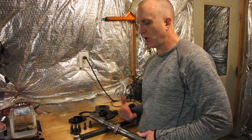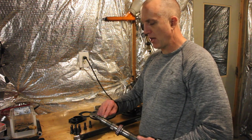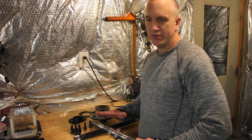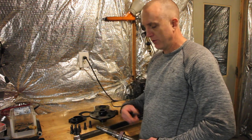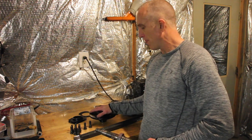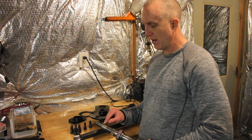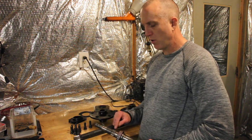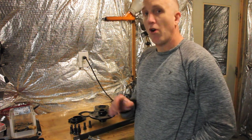What that means is there's too much torque put on the axle and the hub, and this Woodruff key just gets shaved off. Then your hub is free spinning — the axle is spinning but not engaging with the hub anymore because the Woodruff key is gone and the splines are not strong enough to hold it together. So enough of all of that backstory.